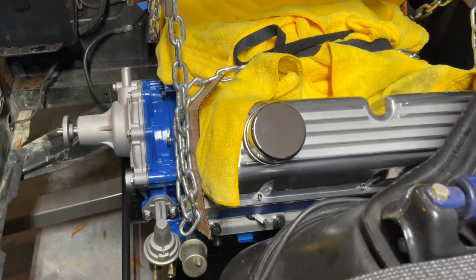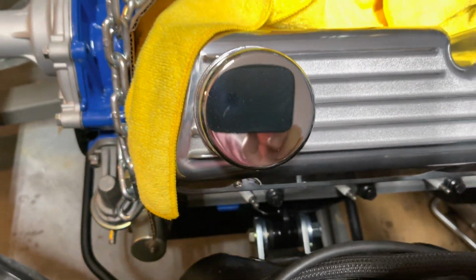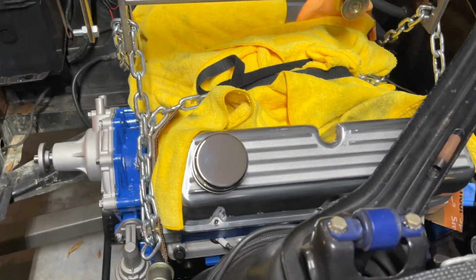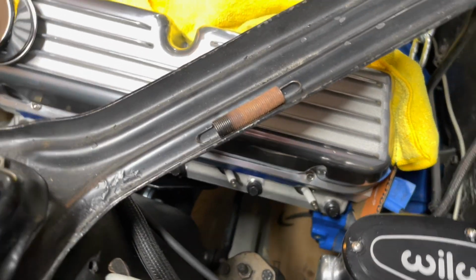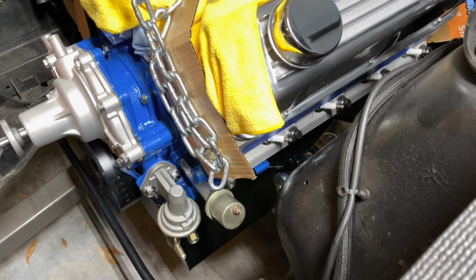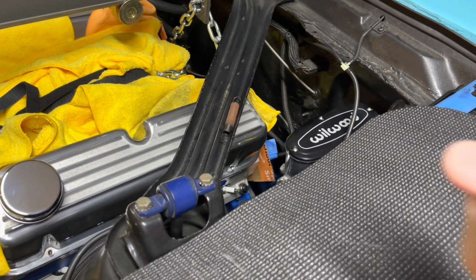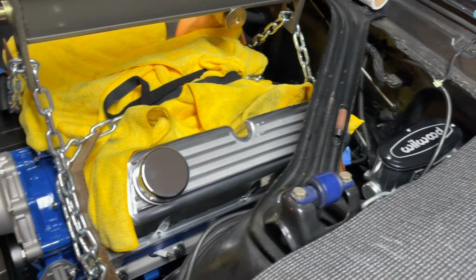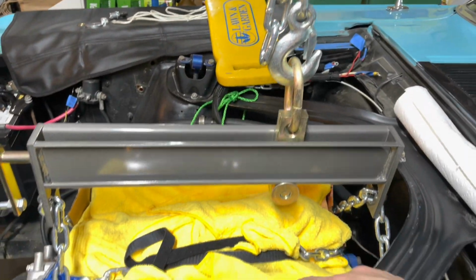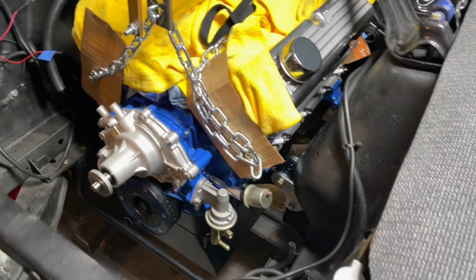All right, I'm tired. It's in there. So I've got this motor mount in. The other one I have the bolt started through half of the motor mount, but I have to take them back out anyway. I'm just not gonna do it today because I have to get my headers in, and I can't remember which side, but I think it's this side. I had to jack the engine up maybe an inch or so to get that header out. So anyway, I got a board propping up the tail shaft in the back, so there's no weight hanging on this hoist, and I'm gonna take it out of here because by tomorrow morning this thing's just gonna be sunk down on the bottom, all the weight resting on there. So, all right, not too bad by myself.